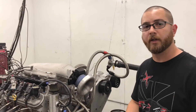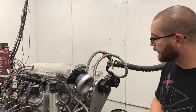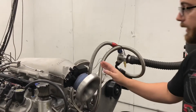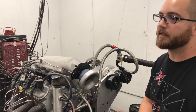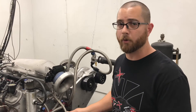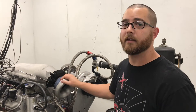It's got our custom valves, Inconel exhaust, custom spring kit done by PAC, also titanium retainers. And we're going to test this intake. Eventually it's going to have a Pro Charger F1R as you can see. But the point of this test is really to see what kind of intakes will make a difference. I know a lot of guys don't have the room for the Holley Hi-Ram. So we're going to test this low compression 408 - it's 9 to 1 compression - so it'll work on pump gas.